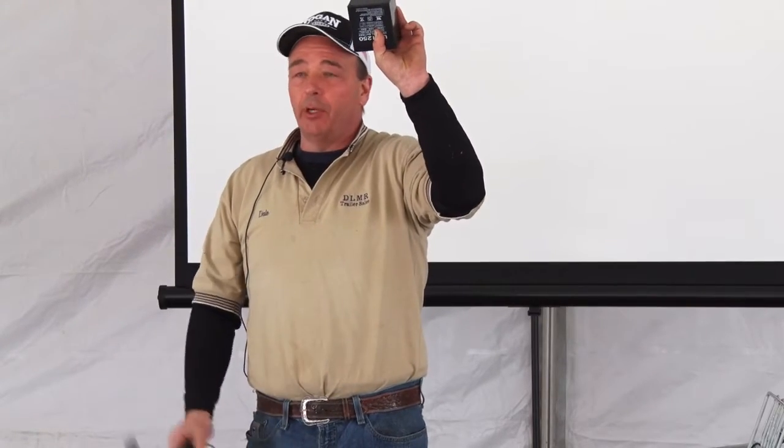And I'm going to tell you right now, if you've got a horse trailer and you've not put a new battery in 3 years, I guarantee your battery's no good. These fail, burn out within the average of 2 to 3 years. The older horse trailers have a plastic box. This thing's set in, and this battery does not get any voltage to it.